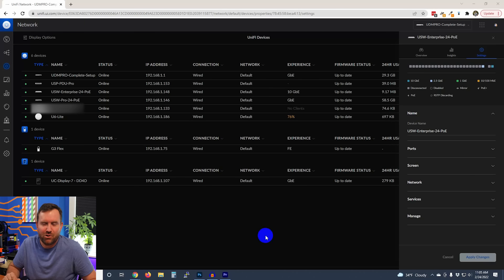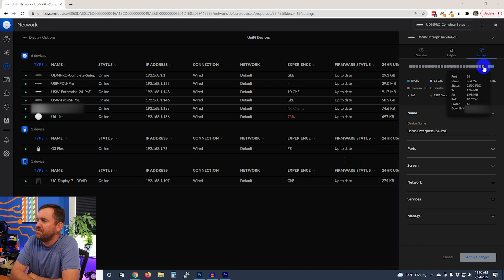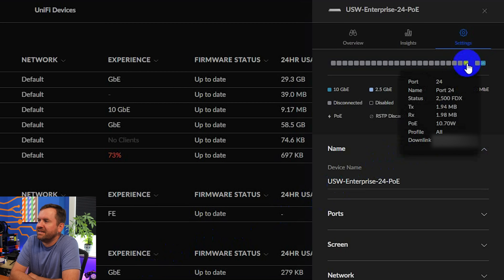For now it is what it is. If you want to see Layer 3 and Ubiquiti videos including what limitations there are, other YouTubers have done a number of videos on that. To prove that this Enterprise switch can indeed do 2.5 gigabit connectivity, I've hooked up a 2.5 gigabit device to port 24 — and yes, it is showing 2.5 gigabit full duplex. Links to everything I've talked about are down in the description below.